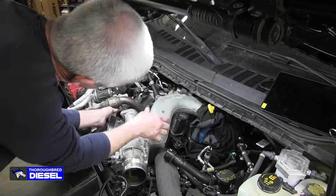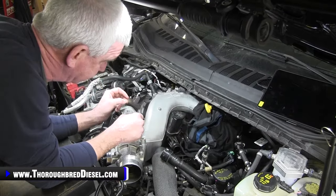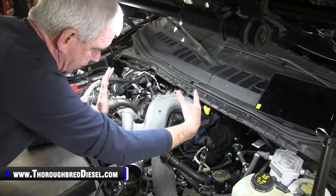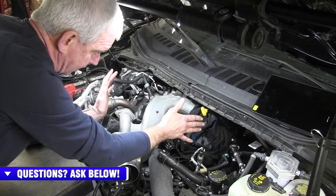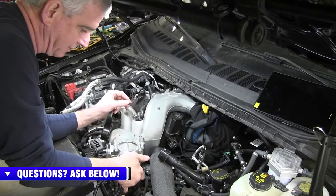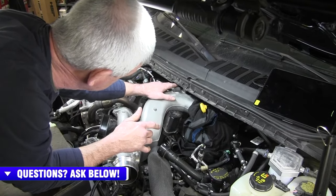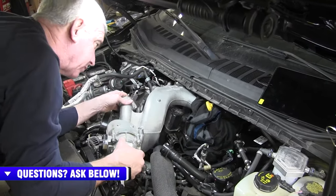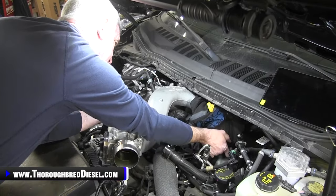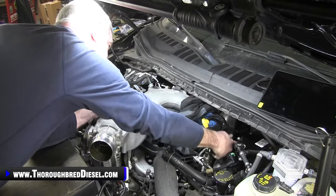All right, first thing I do, lower intake manifold, I'll go ahead and start moving it and get it dislodged from the mouth of the turbo. And then bringing out this upper intake manifold, a couple different things. You're trying to turn the driver's side leg towards the passenger side, all the time being mindful of the throttle valve, the mouth of it. And you want to really watch out for this MAP sensor right here. We're just going to walk it out, bringing both pieces together at the same time. You've got to hold your mouth just right, get it twisted.